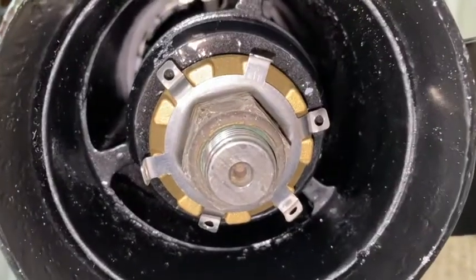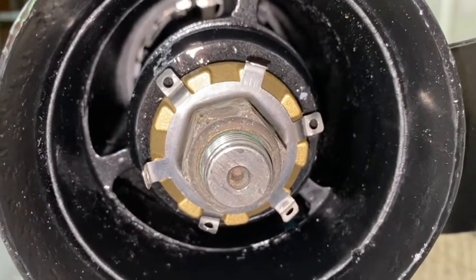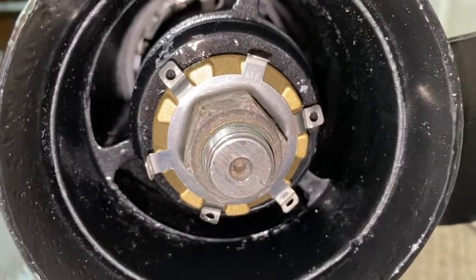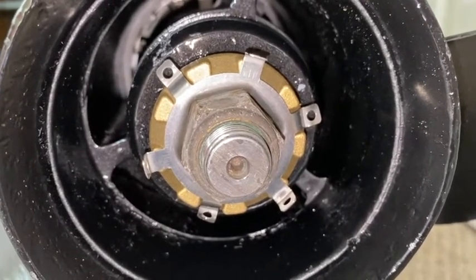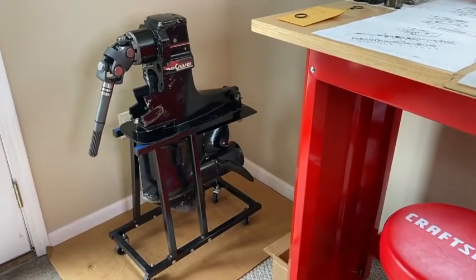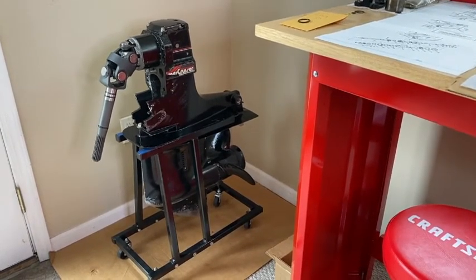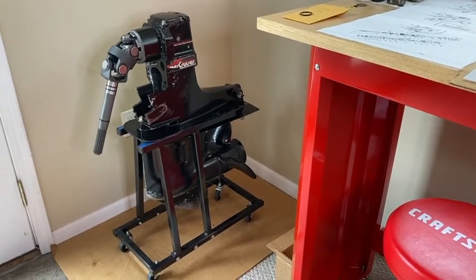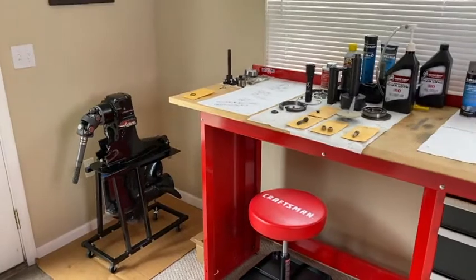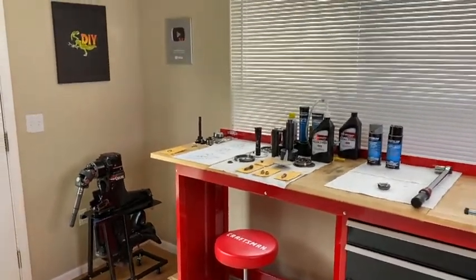Remove the wood blocks. That completes Part 7 of our lower unit full rebuild. We hope this helped. What we'll do next is perform a pressure test prior to adding the gear oil. In previous videos we pressure tested the upper unit separately and all went well. However, now that everything is back together, we are going to do one last pressure test with the lower unit connected to the upper unit — everything installed. If you want to check out that video, it's scrolling above. We hope the video helped — please click the thumbs up, like the video, subscribe to the channel, and ring your YouTube bell. Thanks again for watching.